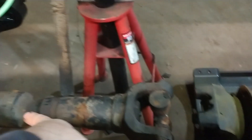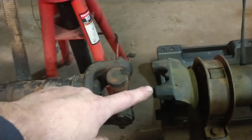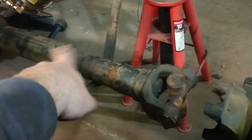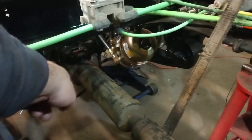So here's where we've ended up. This is the short shaft out of that other chassis I pulled out. After setting the slip yoke where it needs to go, we are three inches too short. Rather than stretching the slip yoke and getting dangerously close to having a failure, we're just going to put a longer drive shaft in here. This is just mocked up so it doesn't actually fit, but I needed to get it in line and get a measurement. This is the slip yoke from another truck, which fits the 1710 joint back there perfectly. It's what's called a half round — it's got full rounded caps on two sides of the yoke and bolt-in caps on the other.